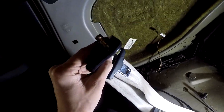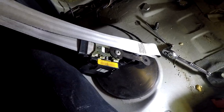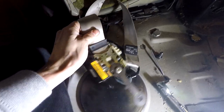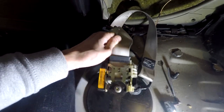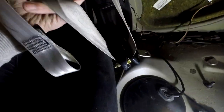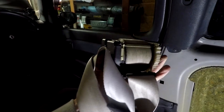A little point to be made: that bolt just sort of stays with it, you can't really get it out, but luckily it comes with the black ones as well. As soon as you take this off - this sort of bottom section - as soon as you take the nut out of the bottom one there, it won't let the seatbelt come back out again, so you feel like you've locked it or jammed it. When I first did mine I was a little bit concerned - I thought I'd broken it straight away. But as soon as you do that and put all these bits back in and bolt it in and tighten it all up, it sort of releases itself and it works again. So don't be too concerned by it locking itself. That is the grubby silver seatbelt out. I don't know whether I'll just try and sell it because some people like the silver seatbelts - they're like 172s. But I am putting a 172 black seatbelt in my 182.